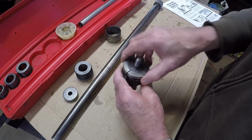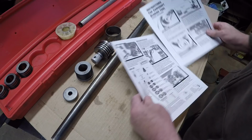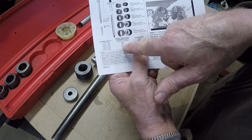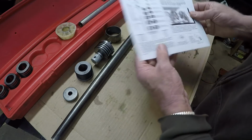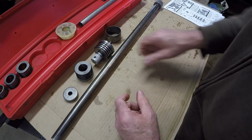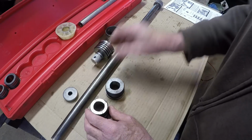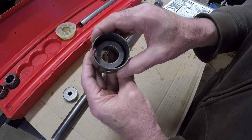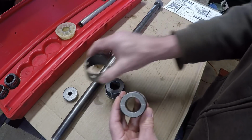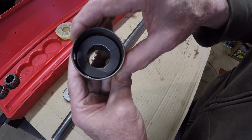Okay, the next thing is on page 2 of the instruction sheet, you'll see bearing size ID with the expander to use on it. Well, on this Super M, the front bearing and the center bearing basically could use 2 different expanders. This one is to the maximum of expansion. Looks fairly loose to me. I get into this one and it's virtually to size.